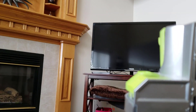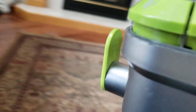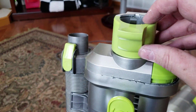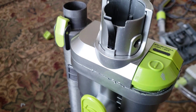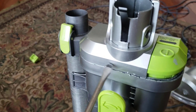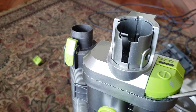The question is how to get this thing off so you can get to the connections. If you just try to pull on those cables — which is what I tried to do earlier — they simply will not come out. So what you have to do is pull these switches out. There's a clip back here that you push in, and you also have to pull this little cover off. Take a slotted screwdriver and pop that off — it's just got two clips on each side, nothing too radical, you won't damage it.